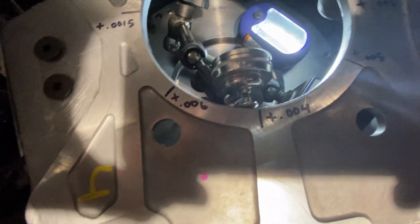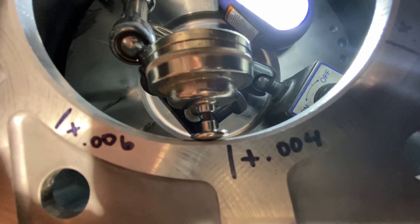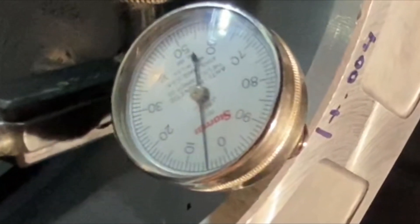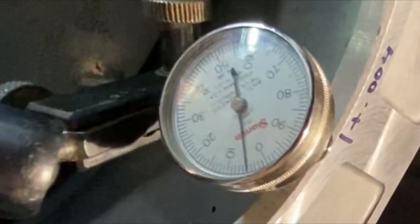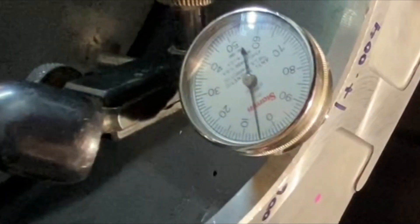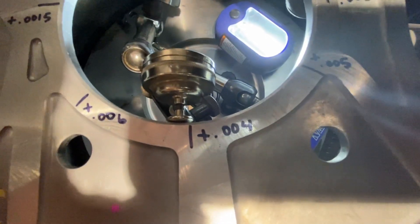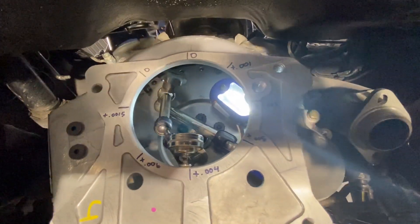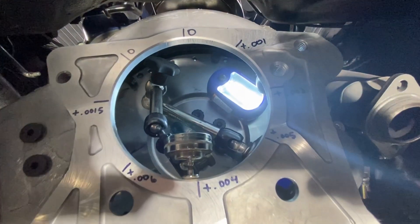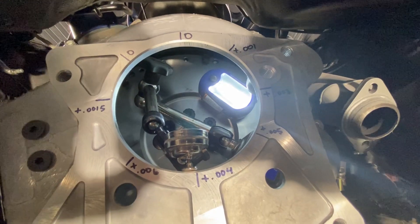My mark is right there and that little plunger is the needle that takes the reading. There's the reading right there — hopefully it's in focus. I record that number, then do the same at every mark, making sure each reading is within spec. I double or triple check each one — I think I've checked about five times now.